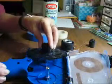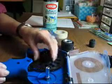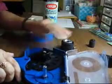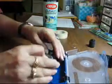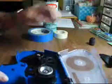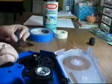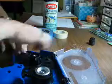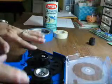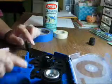For the gears, make sure you put the large one down first and that it engages into the trigger. Then you put the roller assembly back on — you should see some notches where it will just snap right into place. I'm going to stop the video here because putting the screws back in isn't very exciting, so I'll be back with the screws in place, and then I'll flip it over and show you the last three screws that hold this together and the roller.